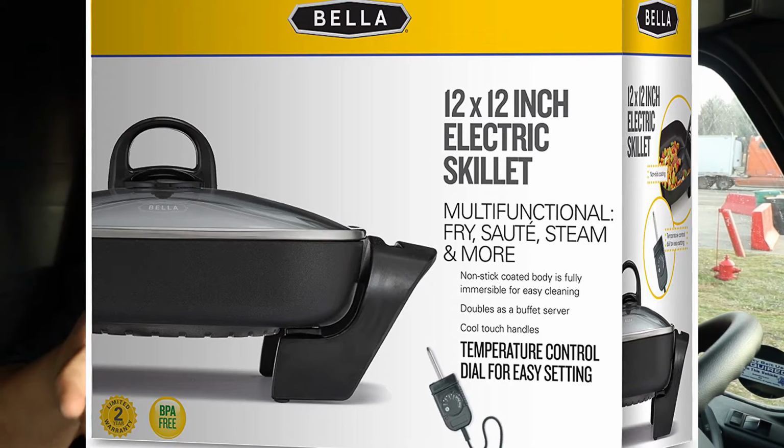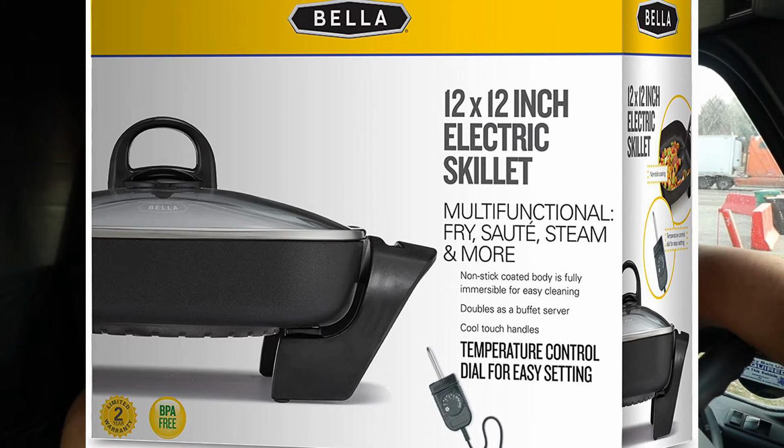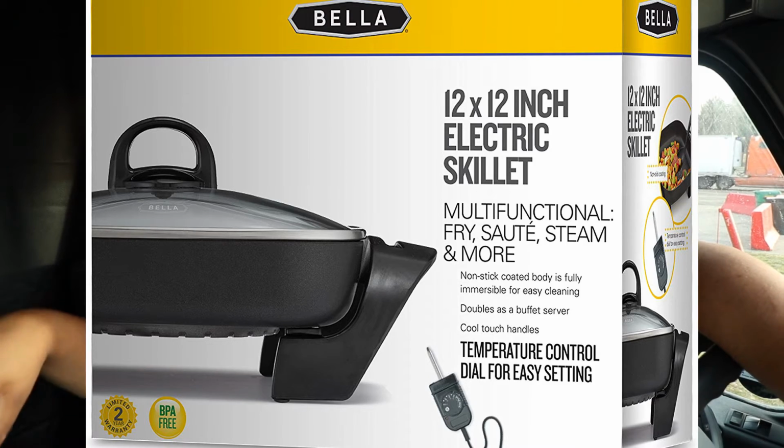The 2020 is very easy to use. You have to have the power on though, if you're going to be cooking in here. So I got myself today a little electric cooker, frying thing, and it takes 1200 watts, and my inverter here is 1800 watts. So when I use that, I have to shut off the microwave, and I can have my laptop on because it's not really going to take that much, because my laptop only takes 200 watts out of the 1800 watts power supply that we currently have in 2020 Freightliners. So that's my take. I really love the convenience.